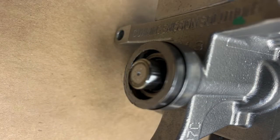Here I flipped it over. You can see the spray tip there in the center, and you see that hollowed out groove around it. There is a white fiber washer that comes in the gasket kit that presses in there. And one of the main things that it does is just help insulate heat from going up into that aluminum housing. You can pull that off and clean it with warm water if the tip plugs up, but we really haven't had any problems with them at all.